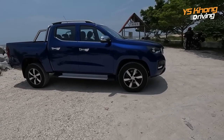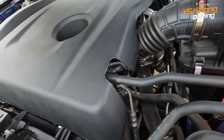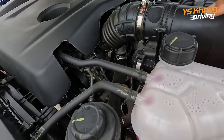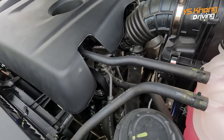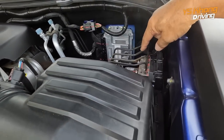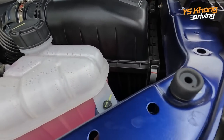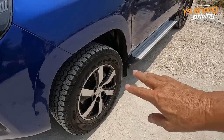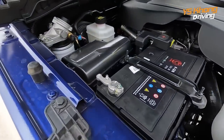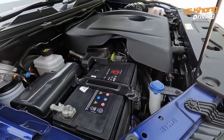Here's a quick look at the engine compartment — it's all covered by a cover. The engine is mounted north-south and the block looks like it's aluminium, so it is a lightweight, modern engine. You can see the ECU for the engine and the ABS here. The intake is very high up, with a hole that goes into the side of the fender. Wading depth is not mentioned but I would estimate around 400mm — don't take my word for it. This is a common rail 1.9-litre engine with 350Nm of torque and 150hp.